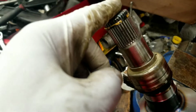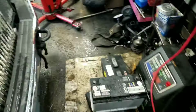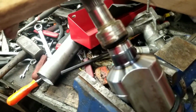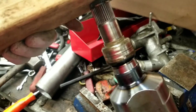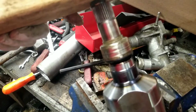All right, now here's the trick to it. You don't want to take a hammer and hit that like so, because you don't want to damage those teeth there. So what I like to do is take a piece of wood and put it on top of that like so, and then I'll hit it. The wood is soft, a lot softer than the metal, so if there's any damage to be done, it'll be done to the wood and the metal will stay the same. You'll take the hammer and hit it right there on the top center, and that'll pop that down.